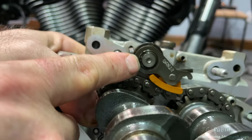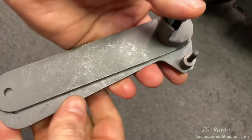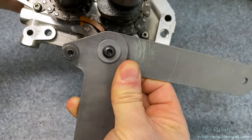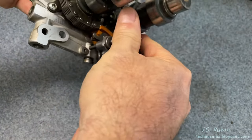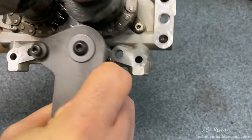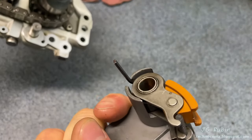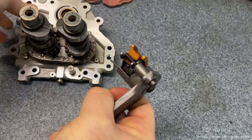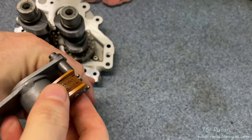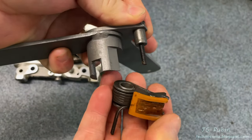We still have to deal with the inner tensioner, which means removing the snap ring — done with snap ring pliers. Now using the inner or secondary tensioner removal tool: it goes over the whole unit with a cutaway meant to wrap around the spring, and a small screw goes through the two teeth to hold everything together. When I pull those two bars together it takes the tension off, and while holding it I'm able to wiggle the piece right out. We can see how it holds everything in place. Slowly releasing tension — there wasn't much life left on this thing — and it pulls right out.